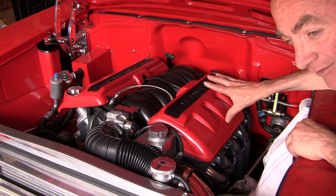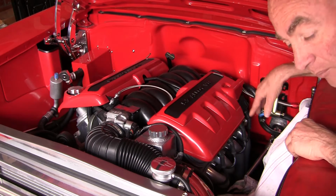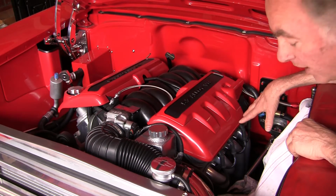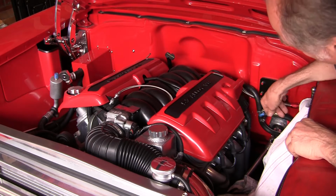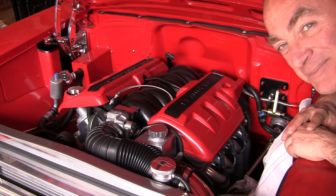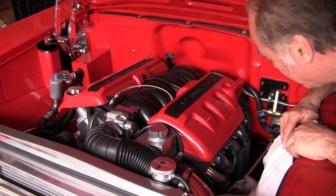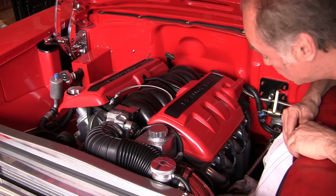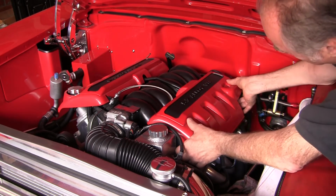And then when I've got the rocker covers on, I know my clearances, so when I put my 8 inch booster, I'll know that there's plenty of room from the rocker cover and all the lines are done properly, and I'll redirect all my lines. So it's actually handy to have all that booster and master cylinder off. So I will start taking these off, just taking all the plastic covers off.